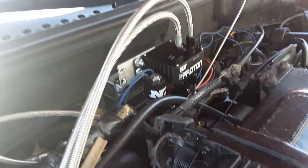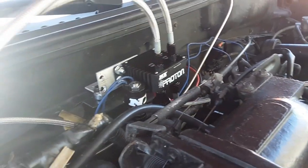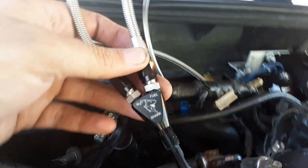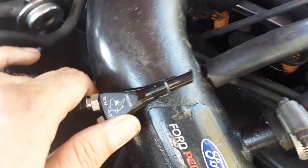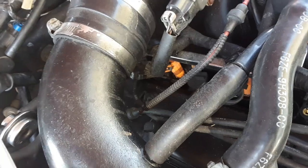All right, more mock-up. So I got the lines going in, got them in their respective side, and I got the nozzle, what they call the shark nozzle, hooked up. Made sure I got nitrous going to nitrous, fuel going to fuel, so there's no discrepancy in length. And basically, I gotta see where this can go. So you want it about 6 to 8 inches away. So I'm gonna put it about equal with that, maybe a little bit more in, but I'm gonna bring it around